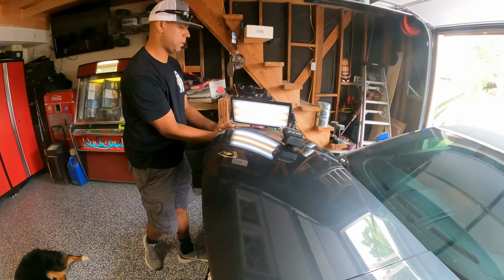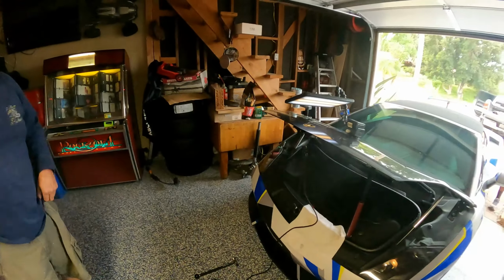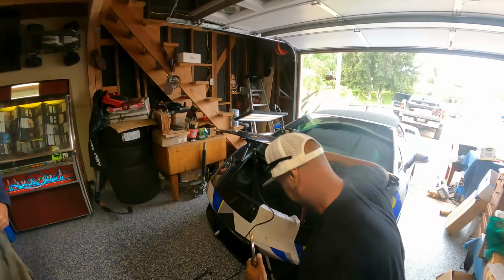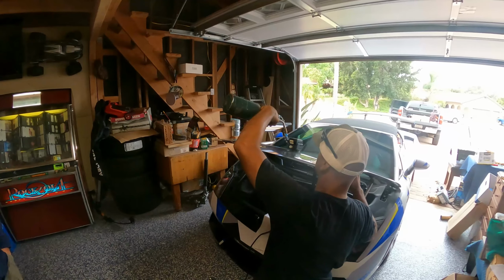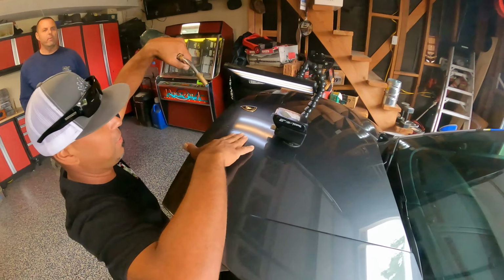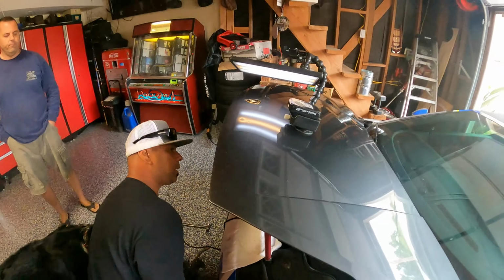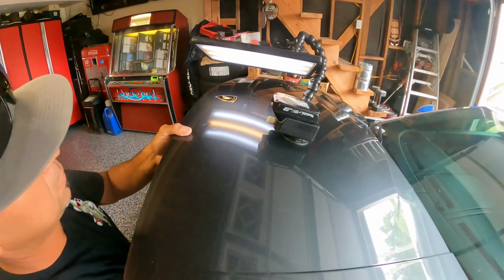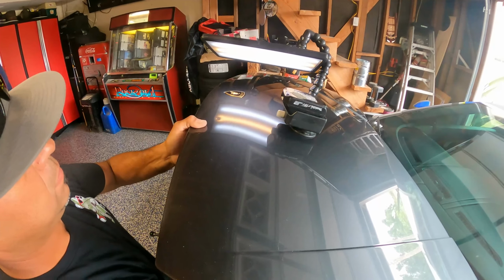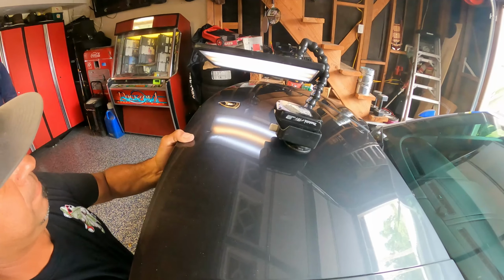Let me see if I can find somewhere to pop this little thing out here. The torch. Yeah, I'm just heating up like it's a hot day. I won't burn your thing. You should have been here a couple days ago. With aluminum, heat helps it expand and just makes it a little softer to work on. Yeah, look at that. It's coming out even more.